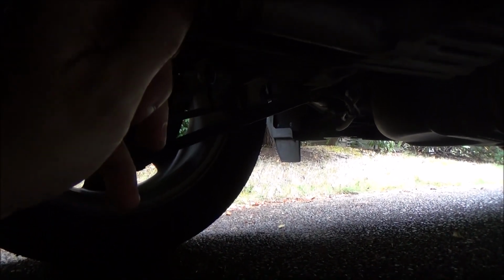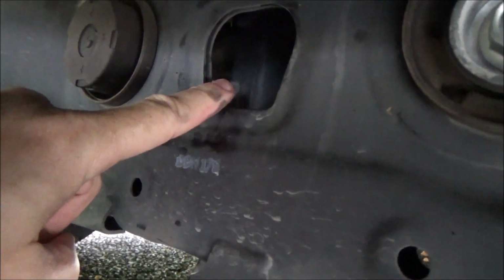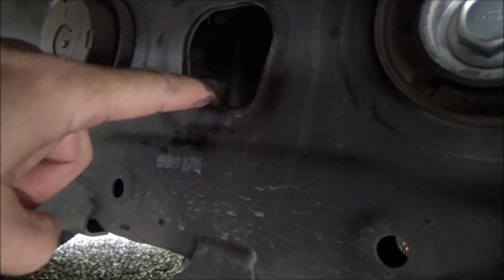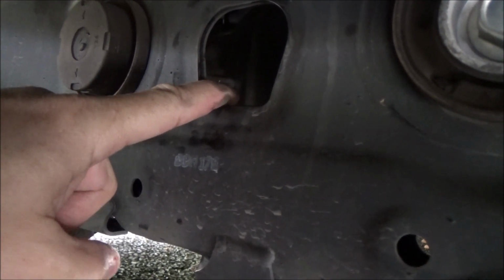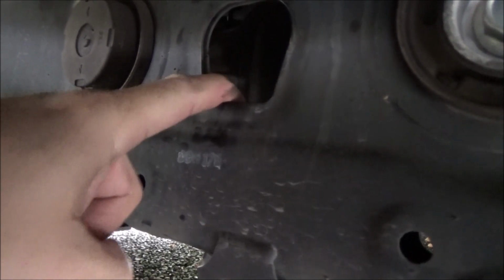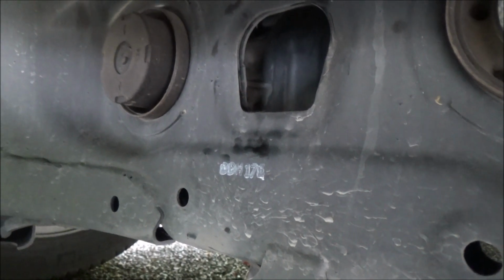And let me go ahead and get this started. I want to start by removing the filler bolt first, because you don't want to drain it and then not be able to break that thing free and put new fluids in. So let's make sure we can get that out first, and then we'll pull the drain bolt. So let's do that right now.